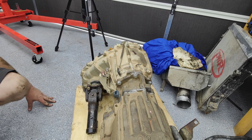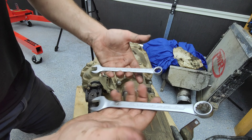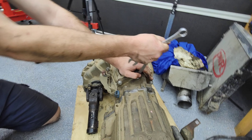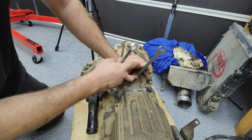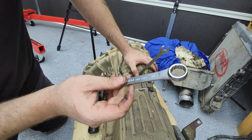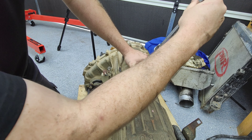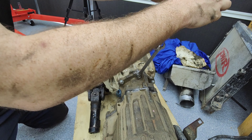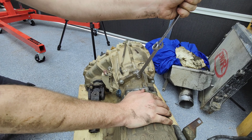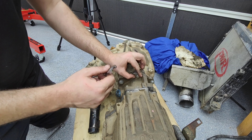If the bolts are really tight — which I'm guessing they're going to be — I'll show you a little trick to undo stuck bolts with two spanners. You get your two spanners: one the size you need, which is your 14, and then one just a little bit bigger. Put your 14 in and lock it — there's not enough leverage on that bar to undo the 14 mil bolt. So what you do is use the ring end of the larger spanner and hook it on the inside. Now you've got double the length of leverage. It's a cool little hack I've been using for years — doubles that leverage and it cracks super easy. Then you just unscrew the old-fashioned way with your fingers.